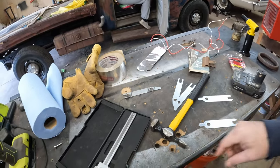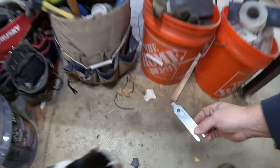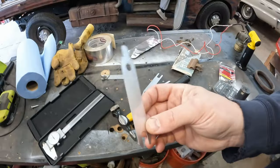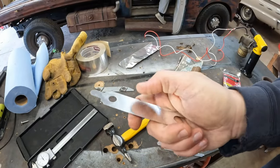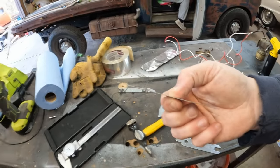So with the micrometer, I found, this one I dropped here, not the one that's in it, obviously, there were two that were 1/64th thickness. And that one is the one that's in there now, and the one that you just heard start, which is precisely how I would like it to start. No grinder, no grinding noise, no metal on metal, just smooth.